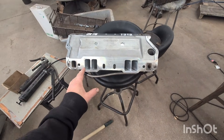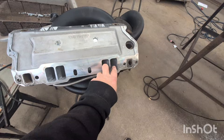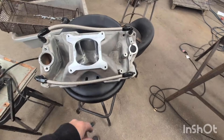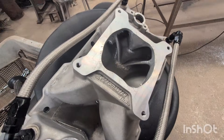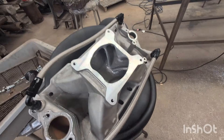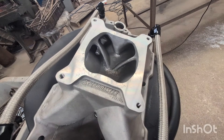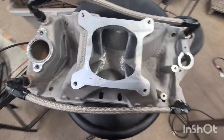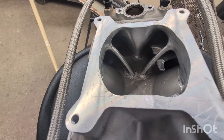Got it all cleaned up — we are done. We got this port matched to a 1206. Like I said, you can see I went in about an inch, inch and a half. That's all — pretty straightforward. Here is the finished plenum. I didn't go down to the bottom, I didn't work the walls — I went through exactly what I explained to you guys. This does make a big difference — I'm telling you right now, this makes a huge difference. This shouldn't take you more than a weekend to do, and you are going to notice it on the dyno and on the ET board. I guarantee it.